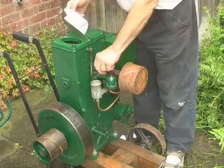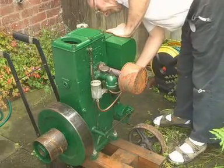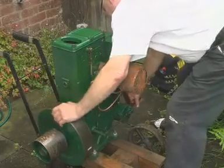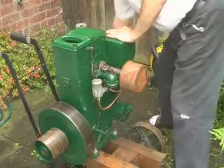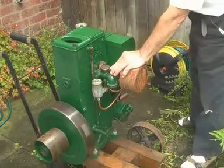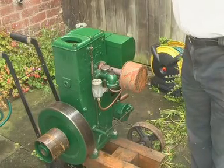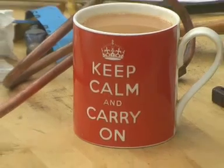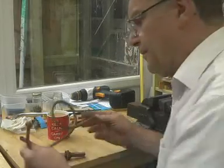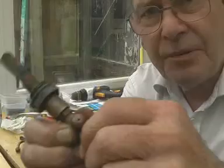Mixture control fully anti-clockwise. Let's see what happens. Take it to compression — it goes this way. I don't think the juice is getting through to the carburettor. We've backtracked a little — drained the tank and dropped off the fuel line, which is fine. But the cock is completely seized up.